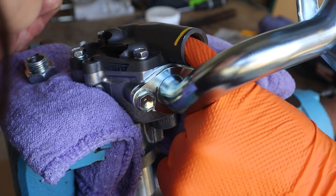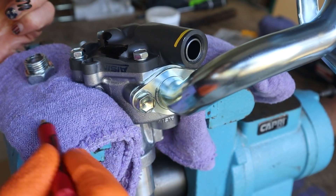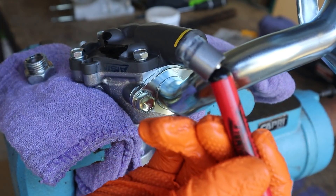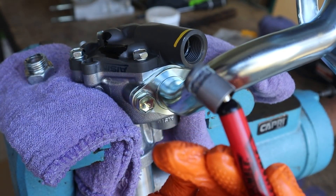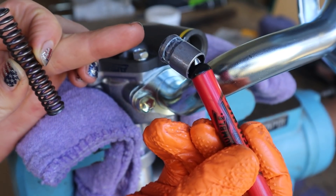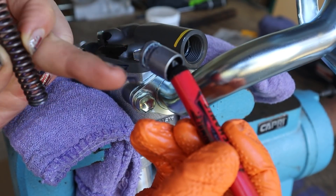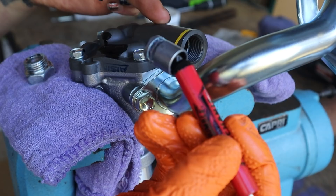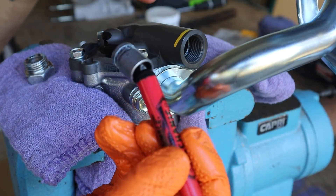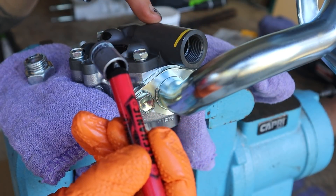Back at the pump — I'm going to use my pinky finger to remove the inner plunger. I always like to apply a light coating of engine assembly grease onto this before installation. According to the factory service manual, when checking an old oil pump, you coat the plunger in oil and make sure it falls into the cylinder under its own weight — dropping in slowly with just a little resistance. That's how you know it's good.